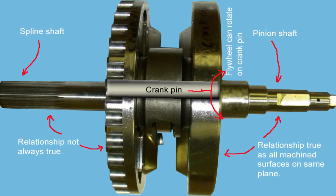One thing to note with all Twin Cam engines: in 2003, they started pressing the crank assemblies together and went with a roller bearing design, which allowed them to crank out crankshafts faster. It's pressed together at somewhere around 40,000 PSI. If you really start putting a lot of horsepower into these, they've been known to shift on the crank pin, and then you get a lot of walk and wobble out of the crankshaft. Does it happen? Yes. Does it happen to every bike? Absolutely not. Also, Harley-Davidson dealers will still typically work on a Twin Cam engine, especially later model 103s, since most dealers won't work on anything over 10 years old.